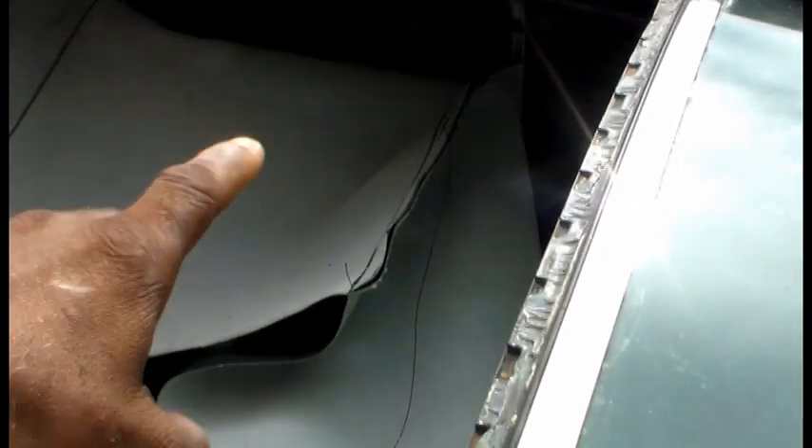Putting the headliners in these with the double liner roof there, I pulled them out. But I put a sunroof in my own car, so I hung my own headliner myself. Is it hard to get this, or you just got to know the dimensions of where each one of these bows go? What you do is take the measurement from the top of the car itself — from the factory, these little grooves here — and you measure the distance in between them. That lets you know which seam, how far to put the seam in between. I see this gap is different from that gap — so when you pull it, it comes nice and straight, all the way around. And you pull it from the back to the front.